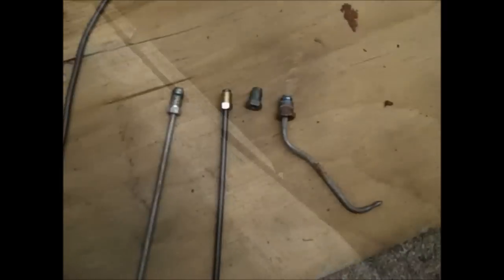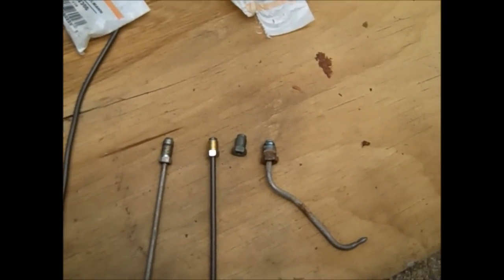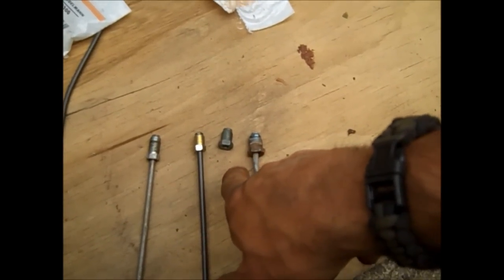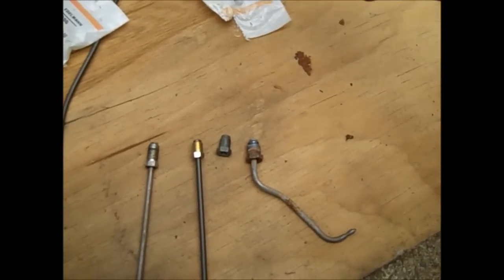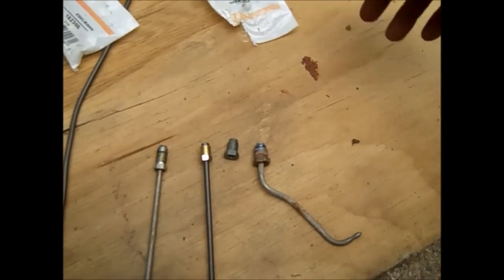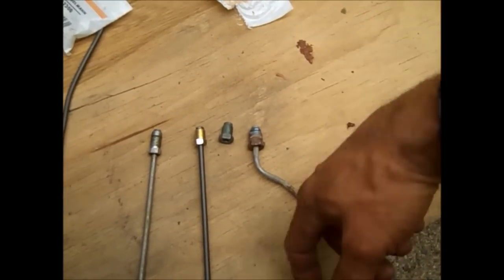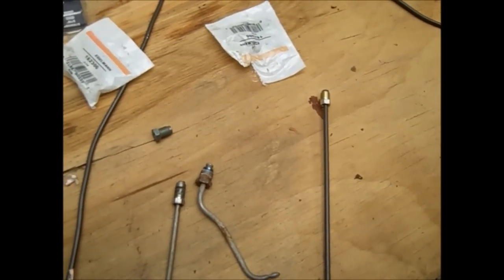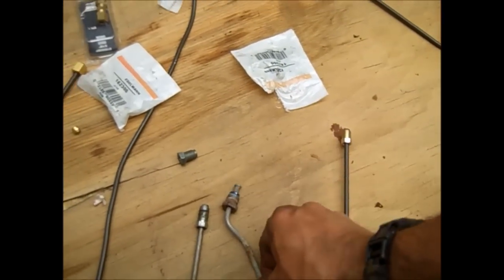Take the union you're going to use, push your clean end in, and tighten that down. You have your old side with the rot cleaned out and your new brake line splice — connect the two, tighten them down, and you've fixed your brake line. Now you already know what kind of unions to ask for. There are actually three different styles of brake lines: European, North American, and Japanese. In the case of this GM it is European brake lines — go figure, that's what GM put in it. The best way to make sure you get the right joints is to bring one of the rotten ends in and match it up, because a lot of times the people behind the counter don't know either.